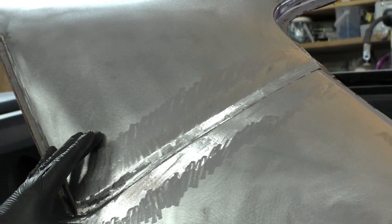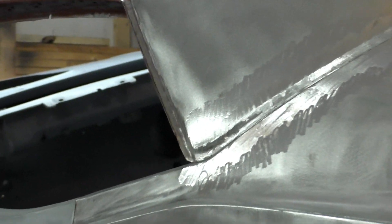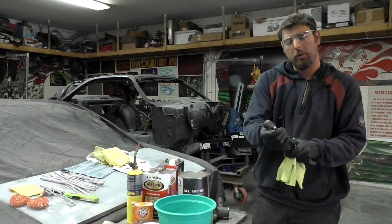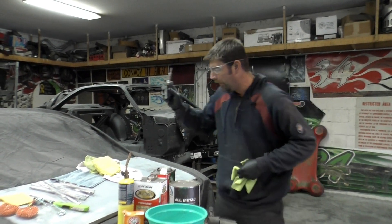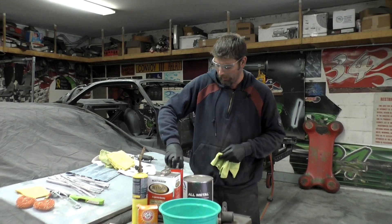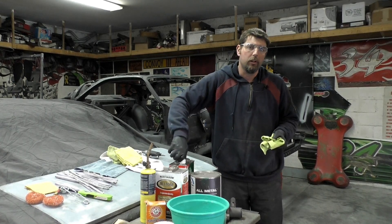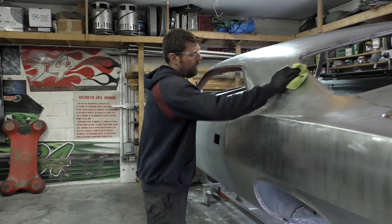We went over a lot further than we're actually going to need to lead in the area. We're going to go ahead and get some wax and grease remover and clean it up. This is a deburring tool — this is what I would get if the area is pitted, along with a really pointy wire brush. You could also brush it by hand but we don't need this since everything was smooth, and you saw I did go over ours with a wire brush too just to be sure. It's all about cleanliness — what's under the lead is what causes it to fail, not the lead itself. So go ahead and wipe this area off with a clean rag.